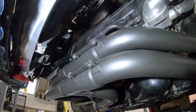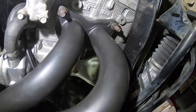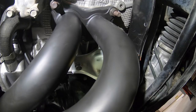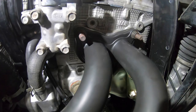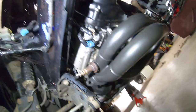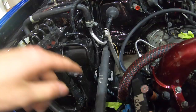I finally got the headers in. I'm super low to the ground here on jack stands, but I got all three bolts on the headers tightened up. You're supposed to tighten them to about 23 foot-pounds — I just hand torqued them since I don't have a torque wrench handy, but make sure you seat that gasket. There should be two bolts on one side and one bolt on the inside on both sides. I routed the O2 sensor up the frame, zip-tied it to the main engine harness, running it behind the ABS pump to the factory plug location.